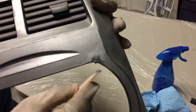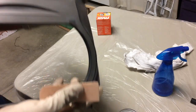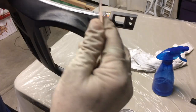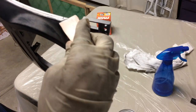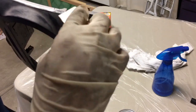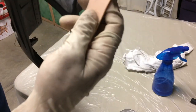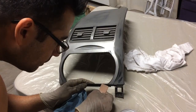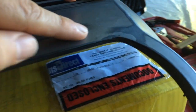See how I'm doing it — I scrape it in and then scrape it out just like that and smooth it out. So far so good. I see little minor imperfections there so I go ahead and fill them. Other areas that need to be filled — so when you primer this sucker, the primer will do an even better job. You can also use it like a putty and let this stuff do all the work. When it dries it's going to dry hard where you can sand it.